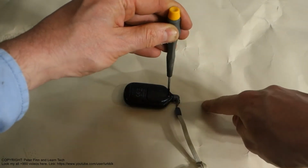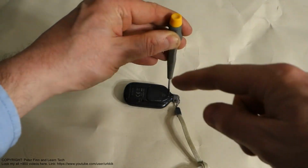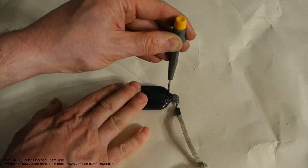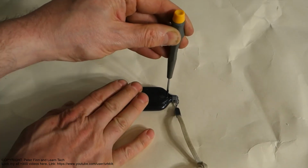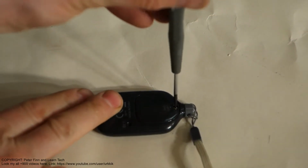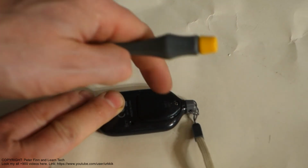And then there is a trick: when we have installed the screwdriver, we need to press it down with quite hard force, not like 1 pound of force, and then we start to rotate it. This is the opening direction, not the other way. I press with my fingers on the step meter, and then I start to rotate my tool in that way. Now the screw is moving, and I take a slightly better view. I only rotate it like 20 times, so much that this screw opens.